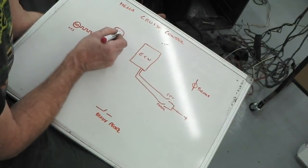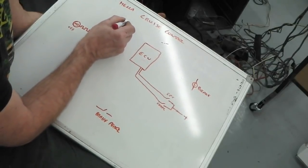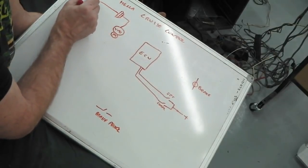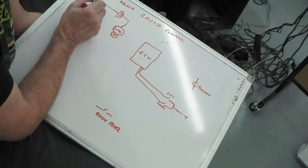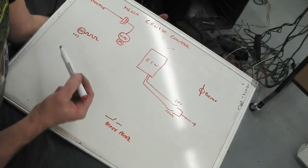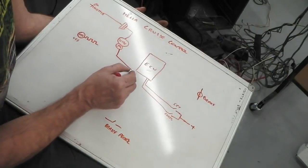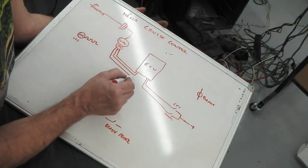So just put vac in there. That's effectively a motor, and that goes to a vac tube here, which goes to a set of bellows, like air bellows, and that goes to a cable which pulls on your engine throttle. So it's on your carburetor, or part of your fuel injection system, depending on your setup; in our case, carburetor. The vacuum pump and motor goes to the ECU. It has three cables: the motor, the ground, and a dump valve.